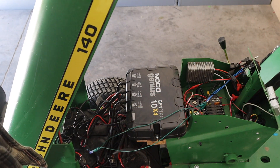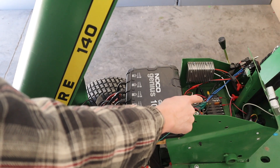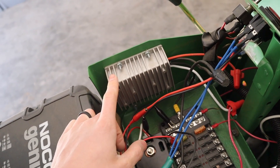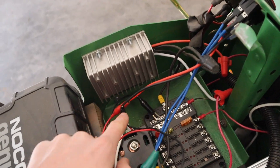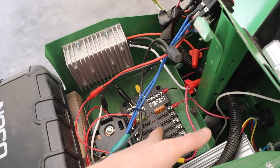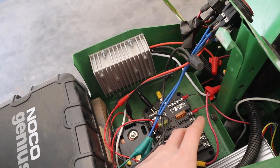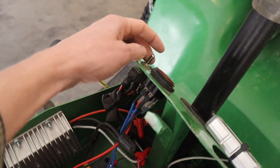It's a 48-volt system — four 12-volt batteries. I also have a 12-volt system: there's a regulator that converts from 48 to 12 volts, which goes into a fuse box. Right now I just have some alligator clips because I was doing some testing for my front hydraulic linear actuator, but it works great. I could plug in essentially anything on this 12-volt system — if I wanted to add lights or any normal 12-volt car accessory, I could just put a fuse in here, which is fantastic.